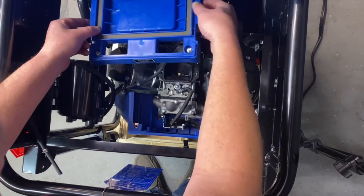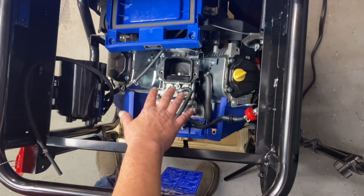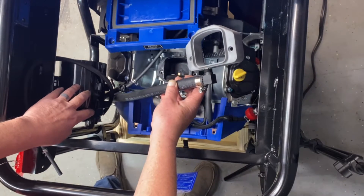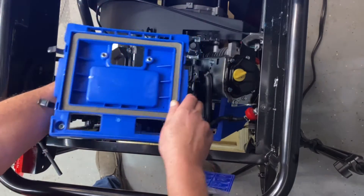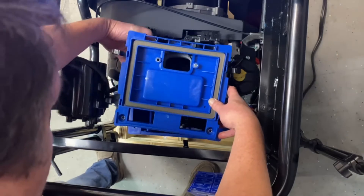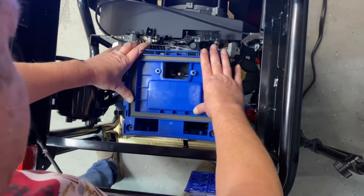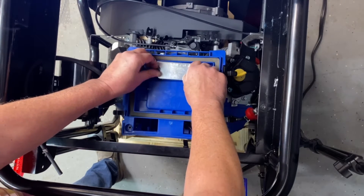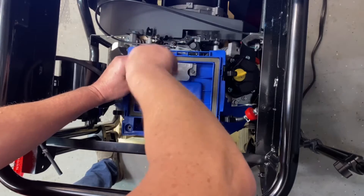Now that we've got access to this, we're going to install our adapter here. You're just going to slide the hose in between the air box — the little booster box — and the side of the engine. This hose needs to be on this side, so when you do this, kind of pull this back and set that on there. Go ahead and bring that down, make sure everything's going to set flush. We'll supply you new hardware for all this. We'll go ahead and start those down — we're not going to tighten them yet because we've got to do the front two first.